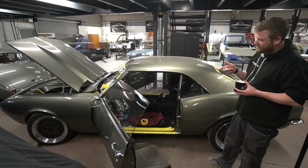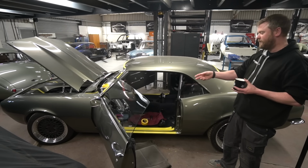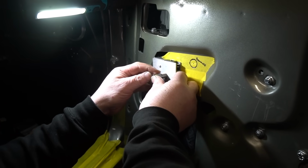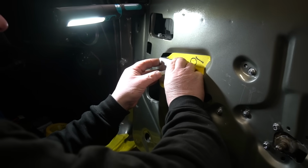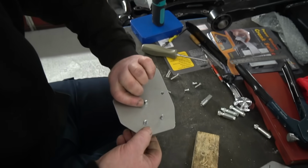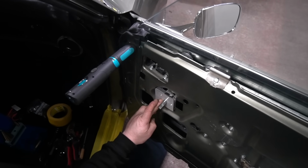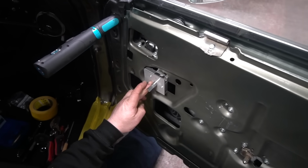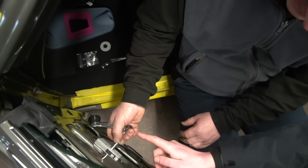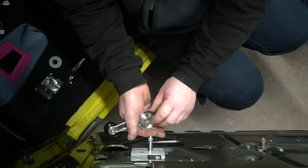And then the switches for the window cranks is what he's working on at the minute. So we're using these switch units that basically replace where the spindle position is for the original manually cranked windows. So you put the original window crank on, but it becomes a switch. So it's just push one way for up, push the other way for down. Might be able to do some clever PDM programming on that. I've got a similar system on Kaiser 2 over there, and because of the PDM electronics, I've actually put some programming in that such that you can control the passenger door from the driver's side with only the one handle, because that is the limitation of the crank handle window controllers that you can't normally control the passenger side window from the driver's side. However, on that, I've done it such that if you do a very momentary click the opposite direction before the direction you want, it does the opposite window.